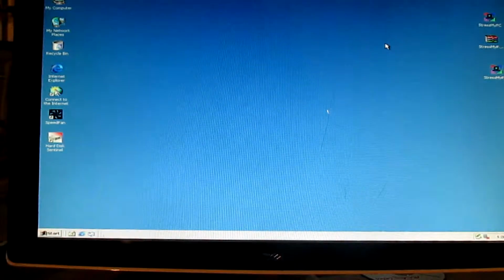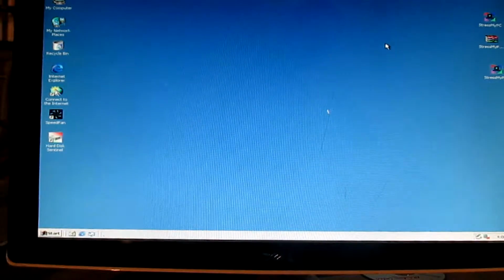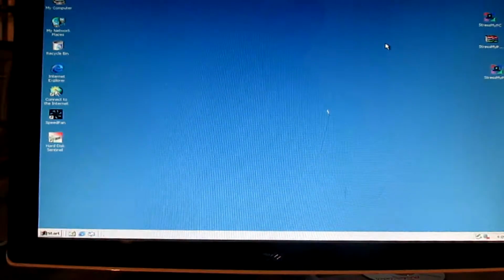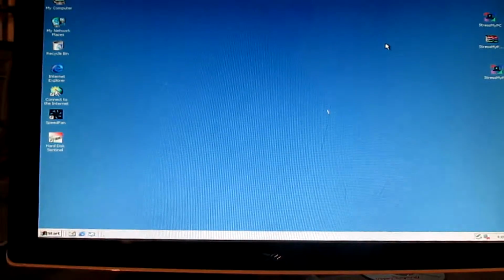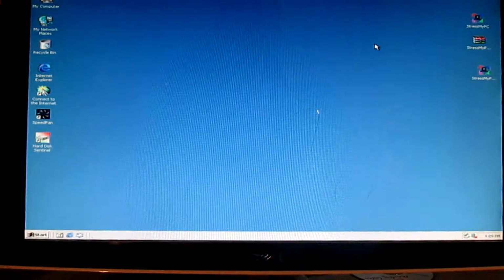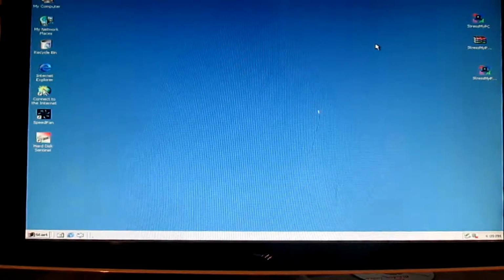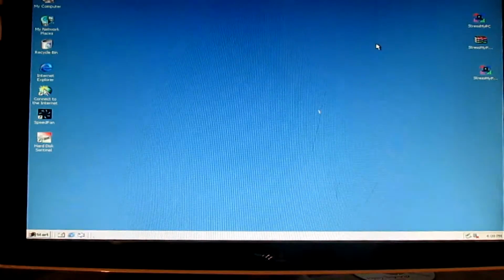I did try one thing though. After digging for a long time, I found drivers for the Express 200, put them on a floppy, and I expected them to work, and they didn't. They did not actually contain any drivers for the Express 200, even though the INI file and the other text files in the driver package said it was the Express 200 driver, and there was no mention of it in the Windows XP setup, which was a pain in the butt. And when I went to load the closest thing, which was the Express 500, because in the BIOS it says Ultra 2/5, it would say that the sys file that came with it is corrupt and it can't load.